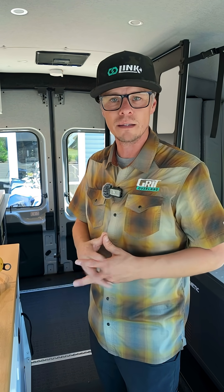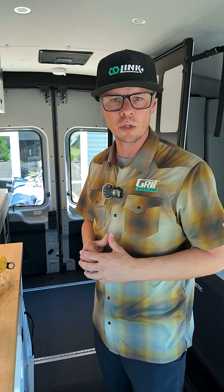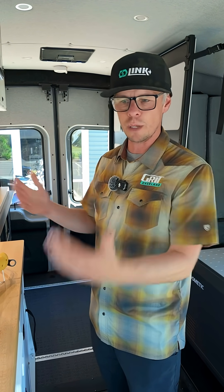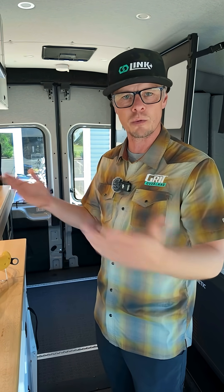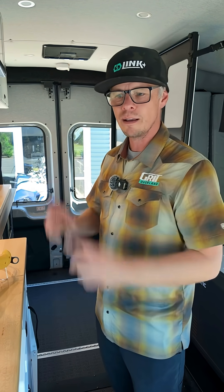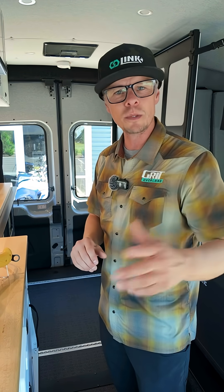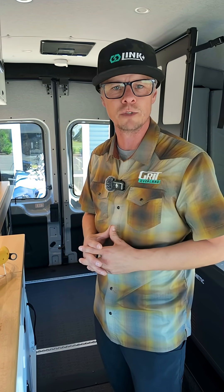That's why we don't run our air conditioner off of AC, even though you can get a bigger BTU out of that. We put a ton more insulation in this van and make it fully four-season. You'll always have to be a little thoughtful about when you're running appliances and which appliances you're running at the same time, but this gives you a lot more freedom with a 12-volt air conditioner. Hope this helps — throw a comment in the comment section if you want to know more, or if you want us to deep dive into another subject.